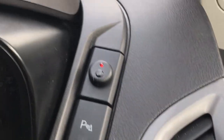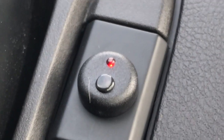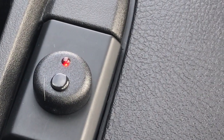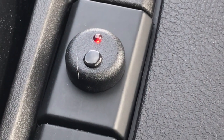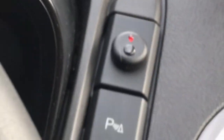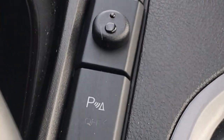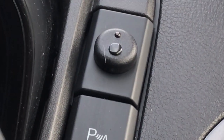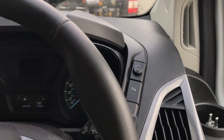You can test the ultrasonics — when you're on the alarm, the LED will illuminate continuously. If you wave your hand within 30 seconds, you'll get a little blink which just lets you know the ultrasonics are picking up. Once the LED starts flashing — it's armed now — if I move, it should trigger.